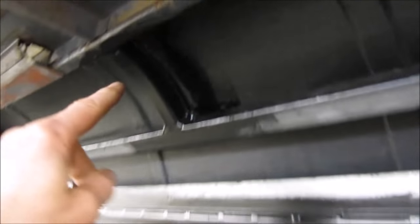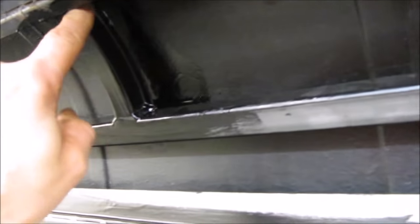I've continued the side stroke roof strut, so I've taken the end of it down to my catch, and the other end, the roof one, goes back to my reinforcement, and that's the original roof brace that would have gone up inside here, joined onto there. Same the other side, of course. It's all been epoxied inside, polyurethane sealed. I'll of course epoxy the whole thing eventually.